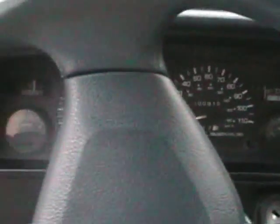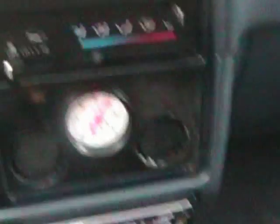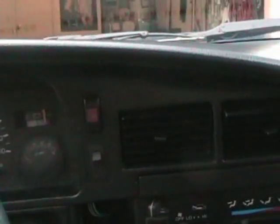The vehicle starts and runs just like any gas car. It's a clutch system. I put the key in the ignition and turn it. The vacuum gauge comes up and shows plenty of vacuum. The volts gauge says we have roughly 150 volts, which is good. The amps are set to zero right now because we're not doing anything. Just put it in gear with the clutch, take it out, and the car drives right away. The vehicle will easily go highway speeds and about 40 miles on a freshly charged pack.